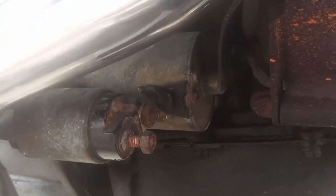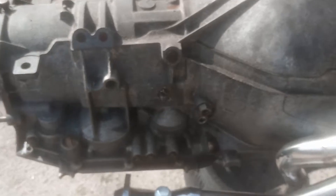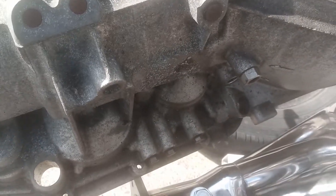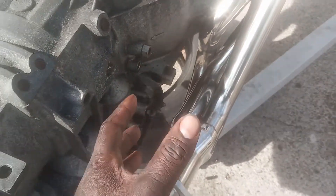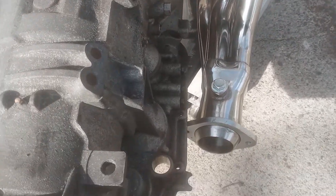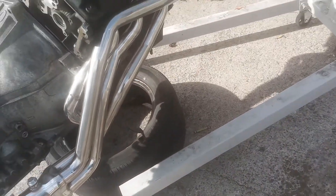The driver's side is the main issue. I know a lot of guys use spacers and all that — I'm trying to stay away from doing that. I believe the only issues are I need one tiny dent, and this flange is going to have to be turned so the screws will face up and down. That's the issue because the oil pan is going to interfere. That's the only issues I see right now — everything else is pretty good.